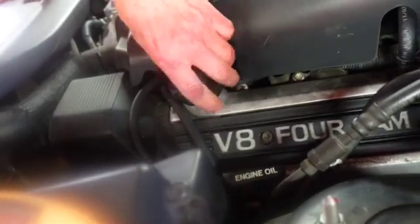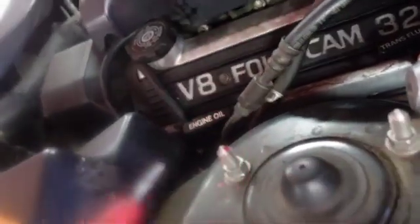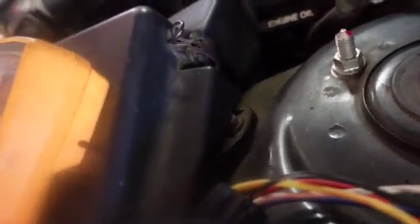we'll talk things over. So I replaced these relays, and the fan, I don't even think I recorded, but zzz, that's the fan blowing. How'd it go? Zzz. So I've been looking for a parasitic draw, and we were at 12.51 about 10 minutes ago. Now we're at 12.6. So you ought to be okay, but I'll check on it in the morning and make sure. Oh, is that where your gearbox fluid is? Ooh, that's a big long sucker.